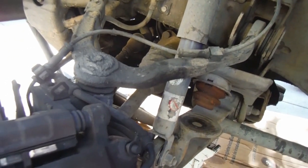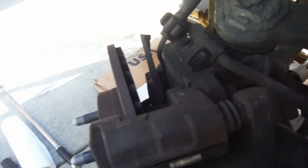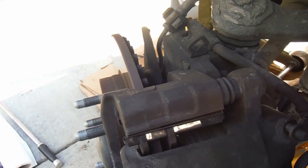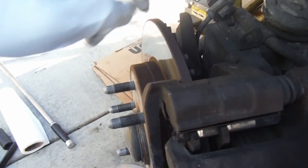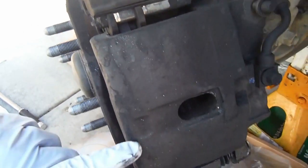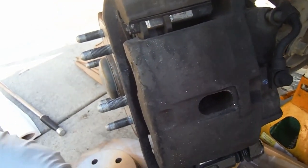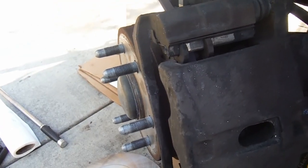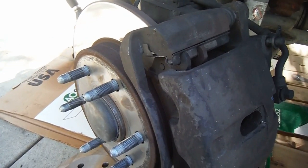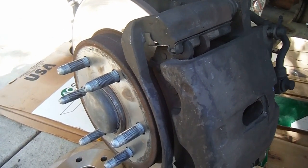This is the four-wheel drive model, a 1500 series truck. You should be able to see right here the brake rotor is gone. The inside part of the disc is completely worn away and gone. That's caused the caliper piston to completely pop out, basically blow out the seals, so it's leaking fluid all on the inside of the wheel well and the wheel is covered as well. I'm going to show you how to change everything in the brake system up front and bleed the brakes and get it back down the road.